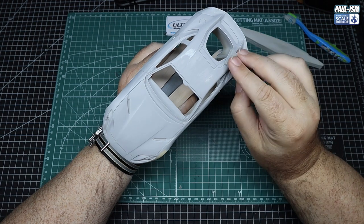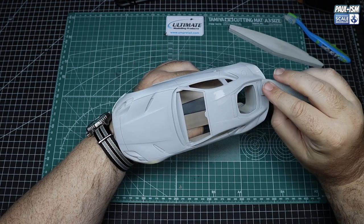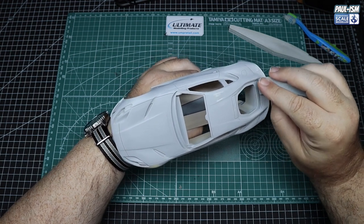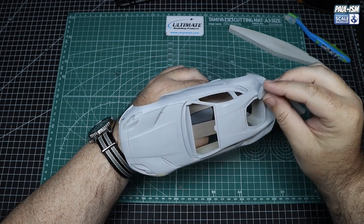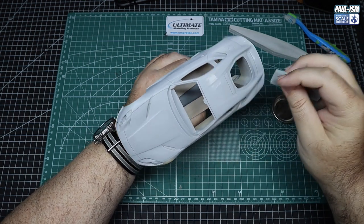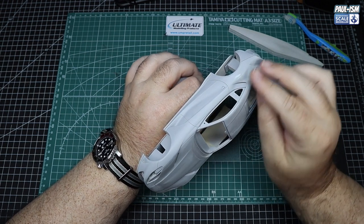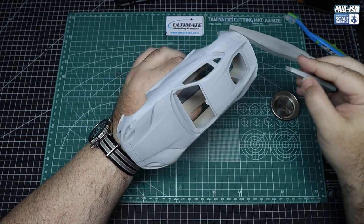The next few coats we'll put down in a minute. We'll probably put two more coats down with a bit wetter on the last one to get the self-leveling properties. So it's going to get about four coats of primer, which has been sanded in between. And of course, that way you get a nice smooth finish. And by putting down a wetter coat near the end, you will get it to self-level quite nicely.